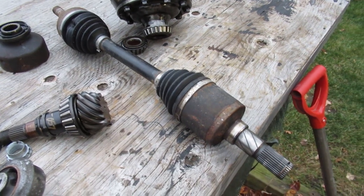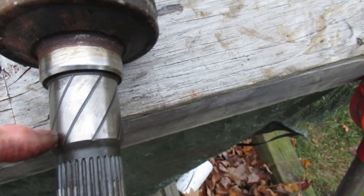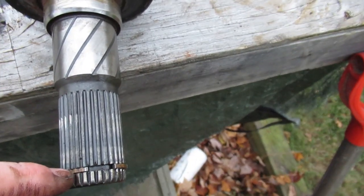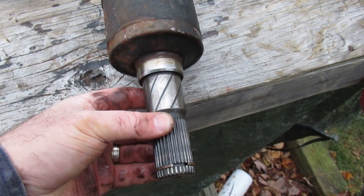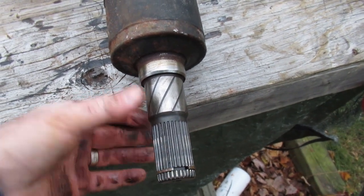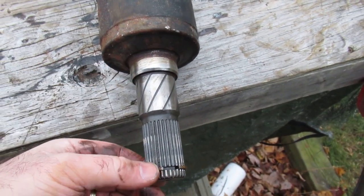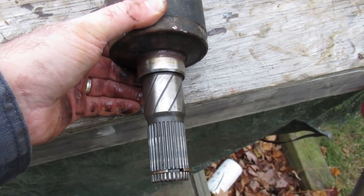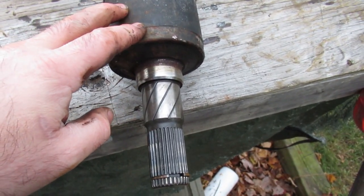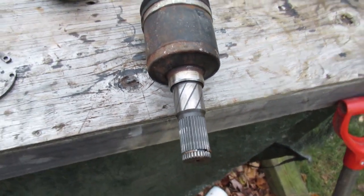Polish the shaft up with a bit of emery cloth - that sucker gets really stuck on. When you're trying to pull it out of the differential, push it in as far as you can first and then pull it out really quick. If you're already pulling and try to pull more, it's just going to bite harder. But if you can push it in and get a little momentum, you can get it to pop out - though it's not easy, and you'll probably damage the seal like I mentioned. So once again, thank you for watching.